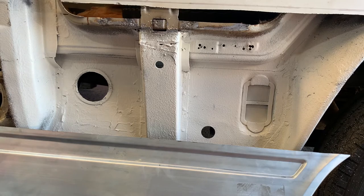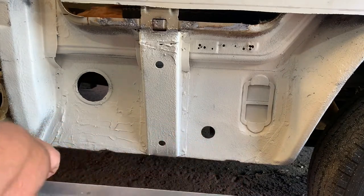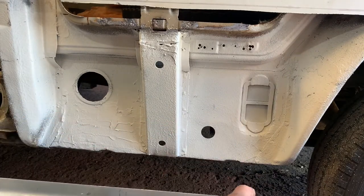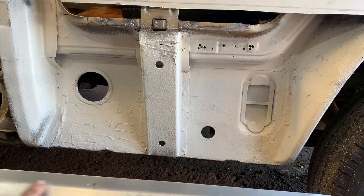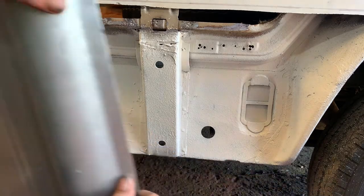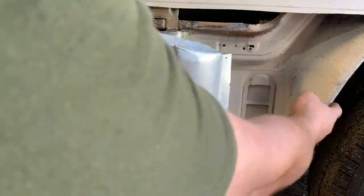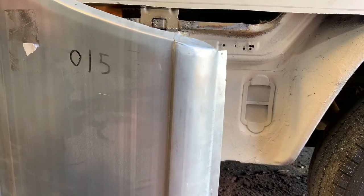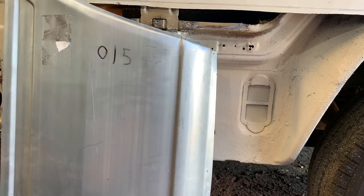The rear is replaced, ready to go, and then the final step will be, I've cleaned all the surfaces along the bottom here back to proper bare metal, removed it all, and we'll put some weld-through primer on, to stop it going rusty afterwards, and then I can actually spot weld this original edge, and then also I can spot weld this edge. I'll have to whip the wheel off so that we've got a nicer finish basically, but that's sort of my plan for Friday.